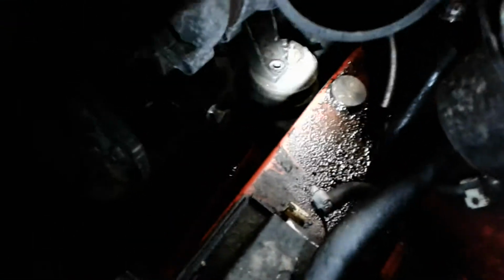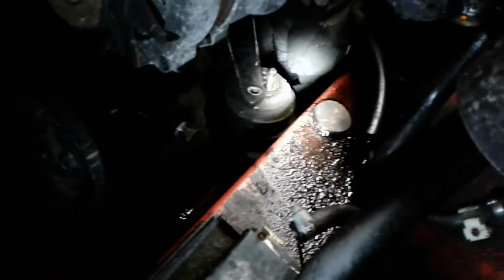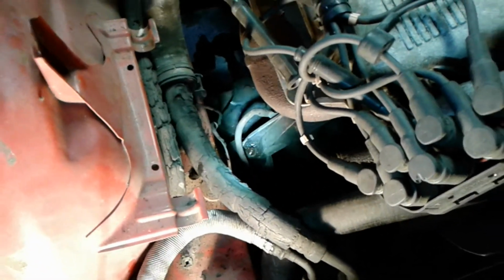So I'm having an issue with this motor mount. The bracket here, it looks like it's kind of corroded in, and it's not breaking free of that stud. See the motor mounts down there. Set the engine back down partially. You can see over here that the stud and the motor mount from the mounting bracket of the engine has broken free. So what I might try to do is set the engine back down fully and try to loosen it up from the bottom of the car to see if I can get the whole motor mount assembly free of the car, and then it might lift up fully.